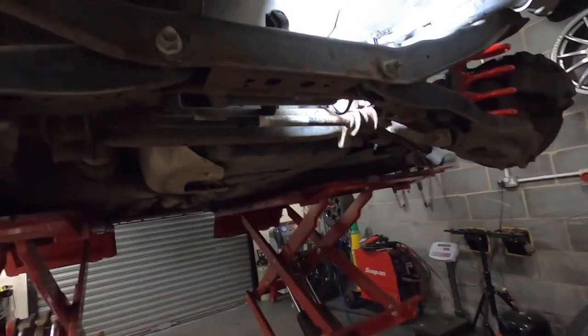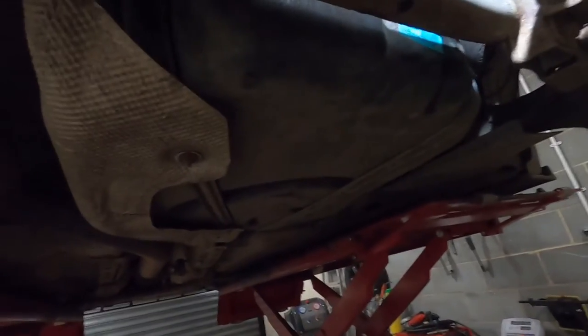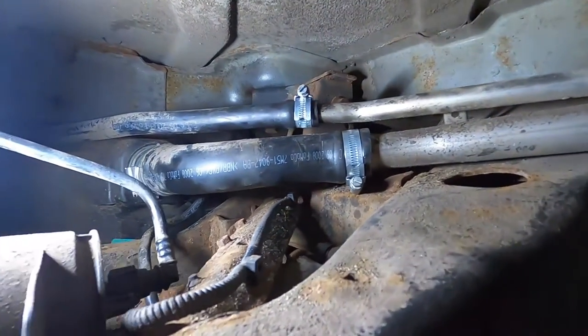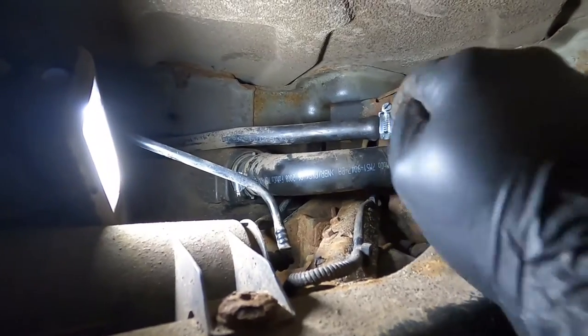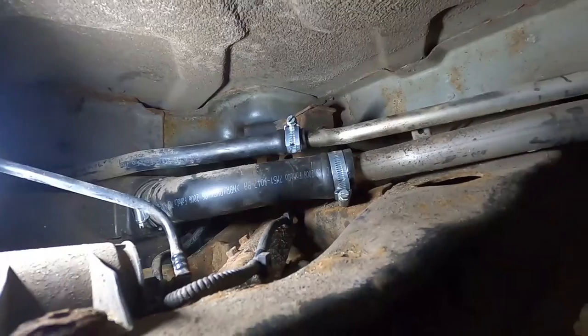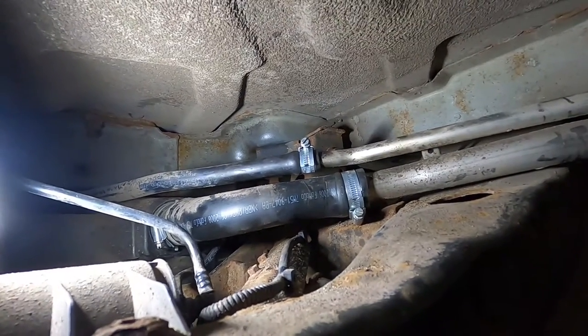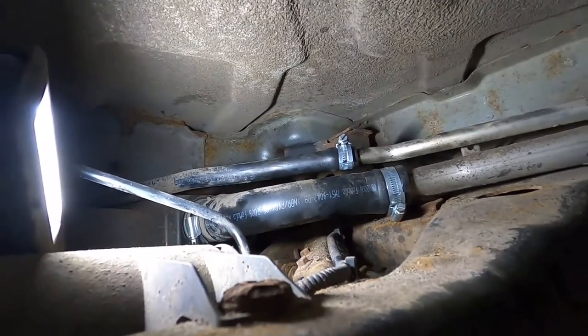Right, we're all back together again now. So the tank is up. Again, that's a bit of a fight getting up there, but that's up there. All three mounting bolts are done up tight. I've got some nice Jubilee clips on this pipe here. This top one here was a nightmare trying to get over that stainless steel pipe. The pipe just seemed really small to go over the mushroom end. But a bit of silicone spray and some brute force sorted that out.